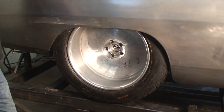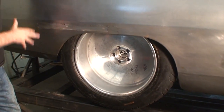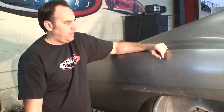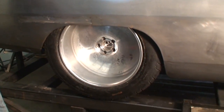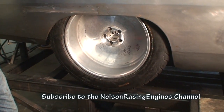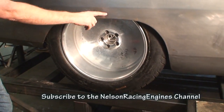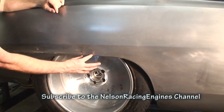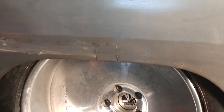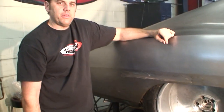This is one of my favorite parts of the car — how we've done the wheel arc and fit this tire in there. The Charger just eats the tire and the wide body up, and it still looks stock. Owner Scott made the decision to go with this monster and it absolutely fits the bill. You can see where we've actually lengthened the wheel well and how we're patching that back into the quarter — some welding and metal finishing still to do, but it's really coming out nice.